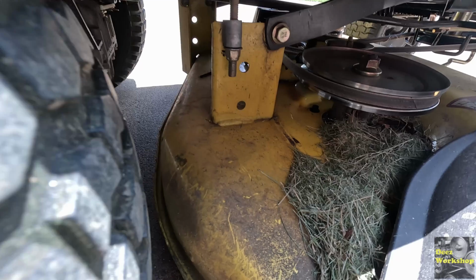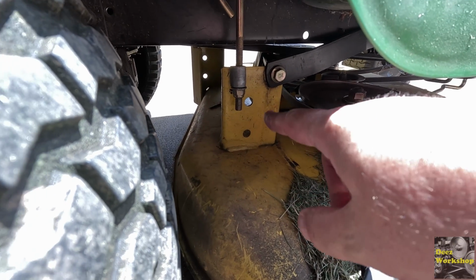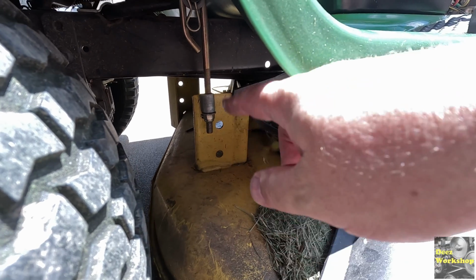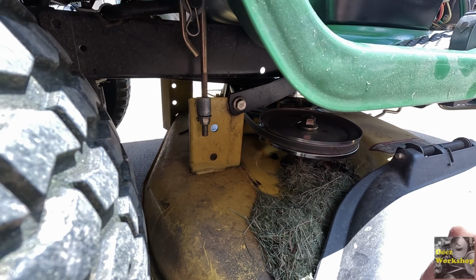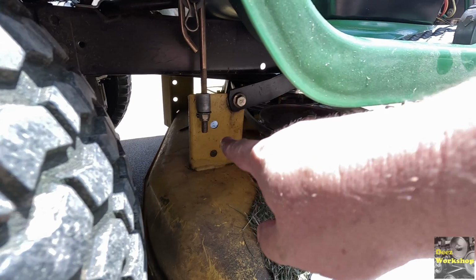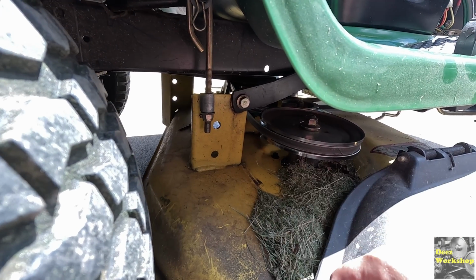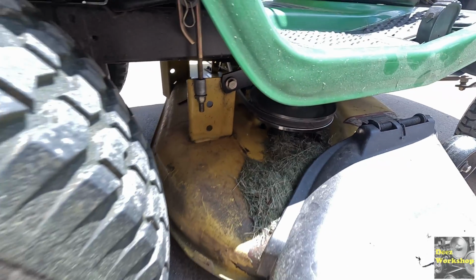that rod right there. So that one wasn't even a 1/2 inch. The other side was 3/4 inch. With that being lower down, that would explain why this was probably cutting lower. So I ended up tightening this one up so that it had about 3/4 thread showing on the bottom, matched it with the other side, and we're just going to test it. We're going to go with that.